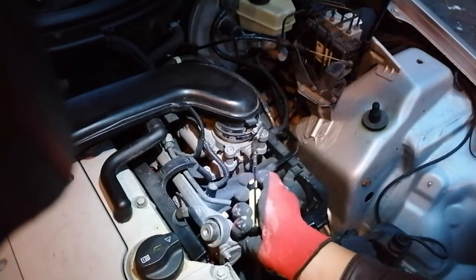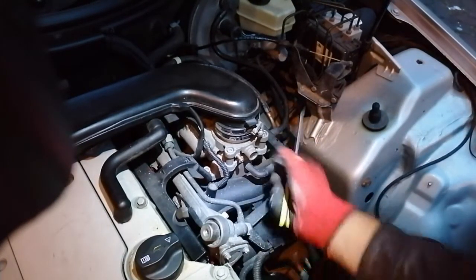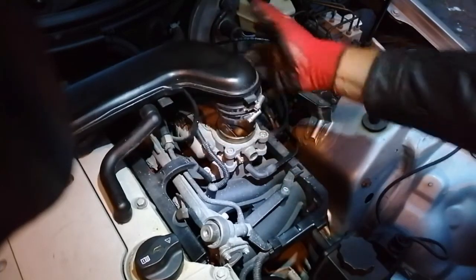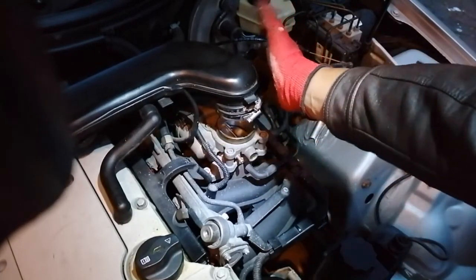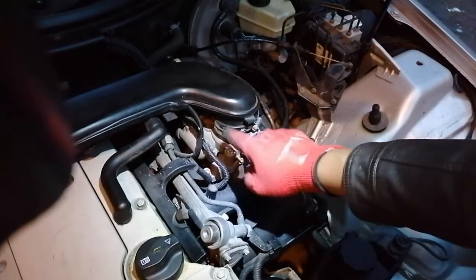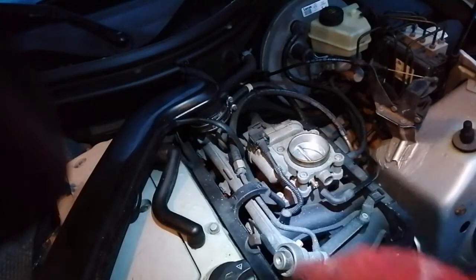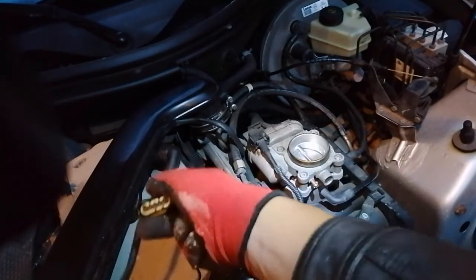As with the quick clean video, we just need to remove these two screws here, loosen them, and then you can pop this right off. And there is our throttle body. I'll grab some allen keys and get this loose. I've moved the assembly out of the way and disconnected the mass airflow sensor, just moving it to the side.